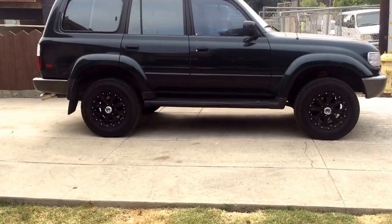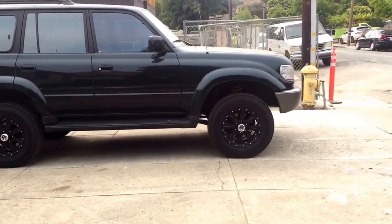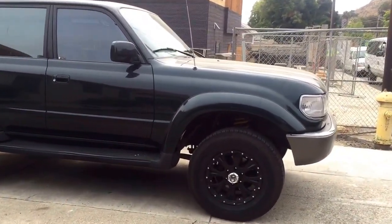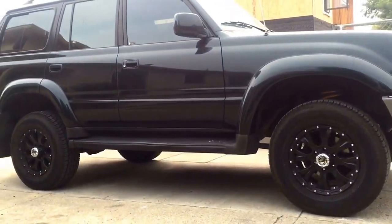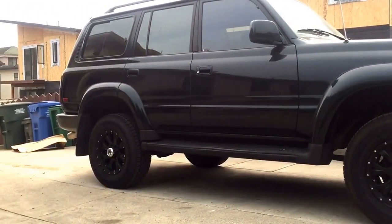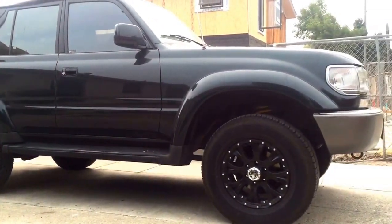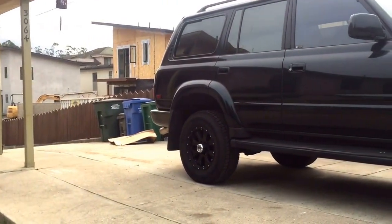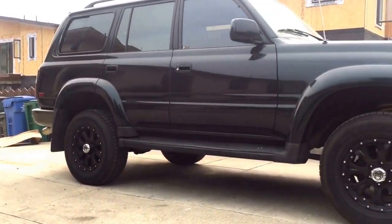And there you have it. 2-inch TJM lift kit installed. No caster correction, no aftermarket shocks. I did some research on shocks, and it turns out the aftermarket shocks for this lift are only a 1/2 inch longer. So as long as your shocks are in good shape, you'll only be losing a minimal amount of travel down flex.